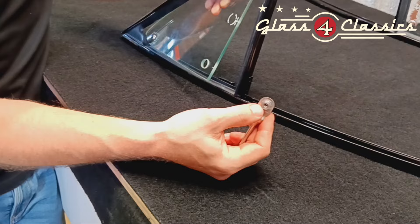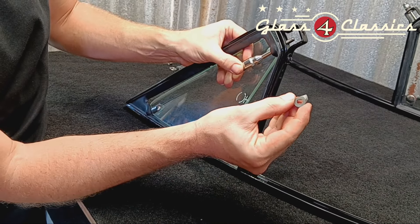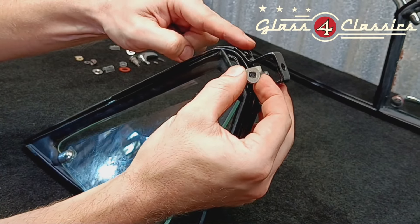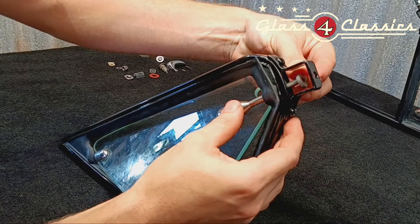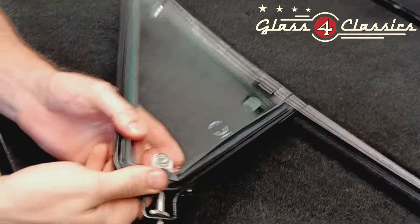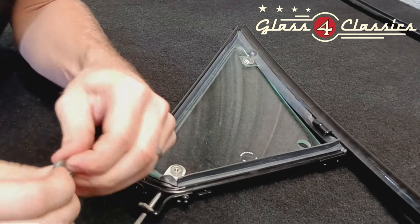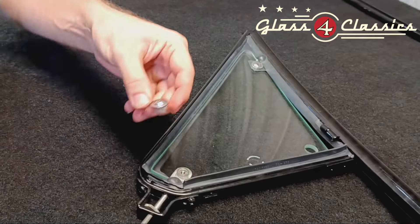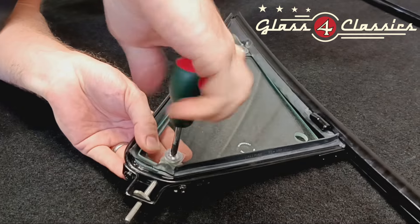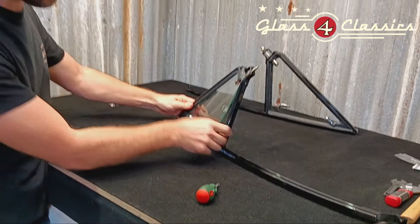Next process is the lower pin. We've already got our clear PVC tube on there to insulate it, so we're going to push this through the bottom. The next step is this particular washer — the easiest way of remembering which way this goes is that the long flat section on the top faces the outside or the front of your quarter vent frame. Slide this through, slip it over the top, then push that through the bottom. Flip this over — we're going to do the same again with our nut and our piece of PVC pipe tube. You can use a rubber washer or fibre washers. I like this because it does a really good job of insulating and stopping any vibration. Tighten this up, about 80 or 90% to start with. Just make sure this is pivoting as it should and your top hasn't slipped out.